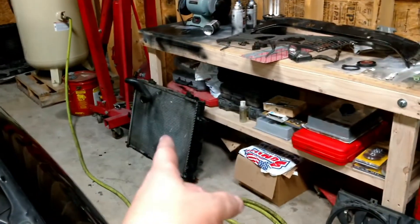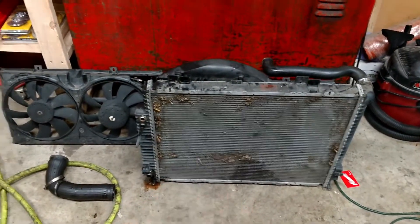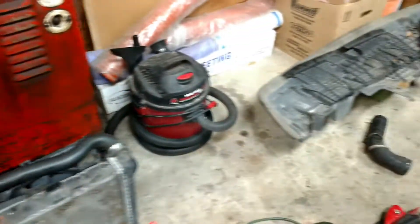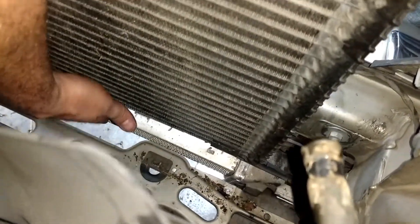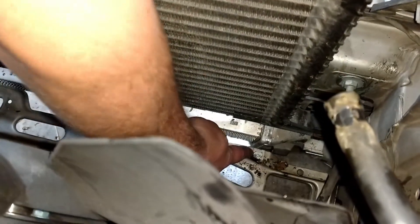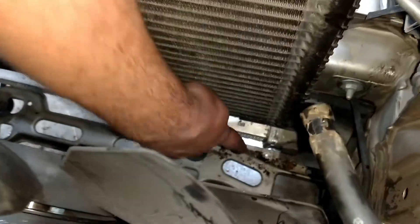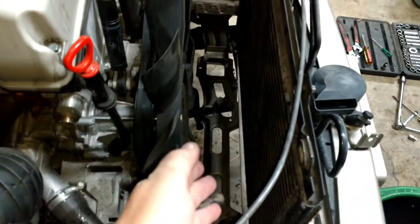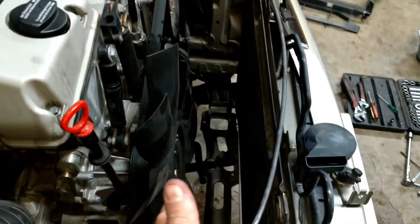I've got all the parts out of the E300s — there's the radiator from the 280,000-mile car and the 98,000-mile car. The tricky part about removing these radiators is that the intercooler bolts directly onto the radiator. You have to remove the bolts and stick a screwdriver in from the bottom to pop it off the radiator — it falls about an inch — and then you can free up the radiator.